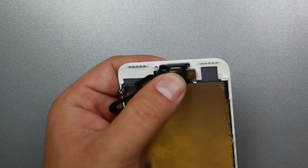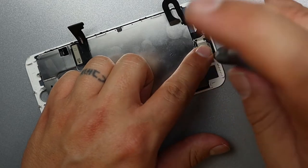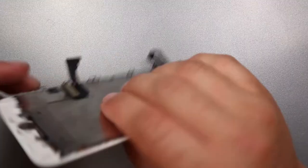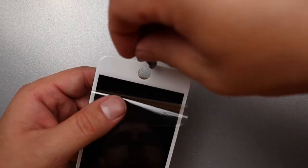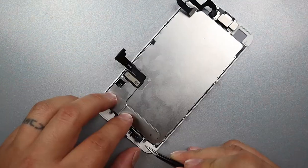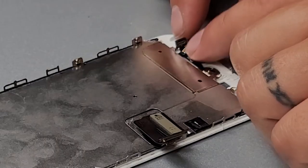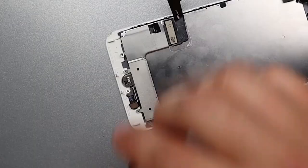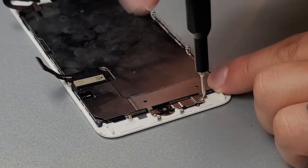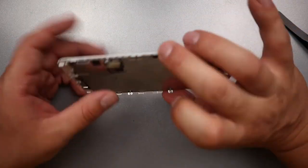I'll put the earpiece speaker in, fold the camera over, hold the ribbon cable down, and get the shield plate to hold them in place. Grab the five Phillips screws and seat them back into the shield plate. Peel the plastic off the new screen and slide your home button into place — make sure you don't have any of the gasket that seals the home button pinched in the frame. Put the home button ribbon cable underneath its attachment on the screen and connect them together, then put the shield plate back on the home button. Don't forget about the Phillips screw down here if you're doing the 7 Plus.